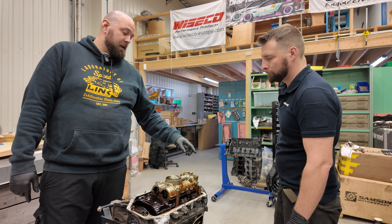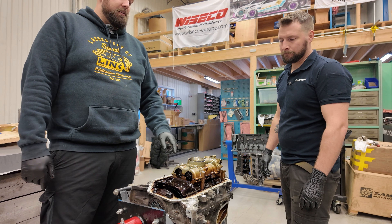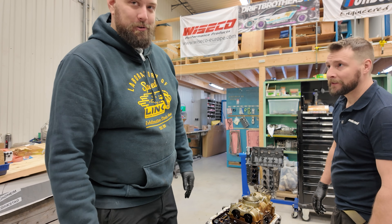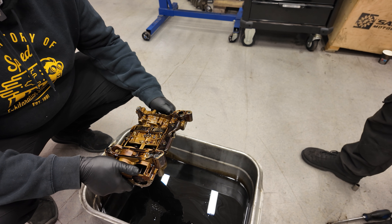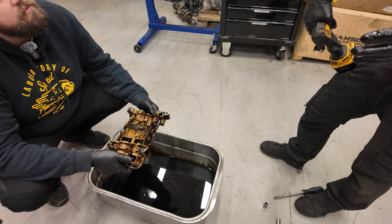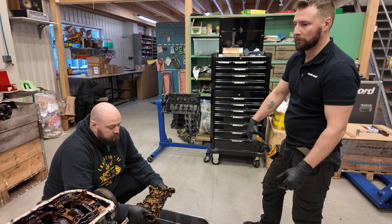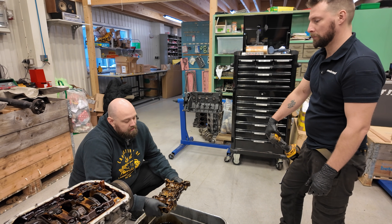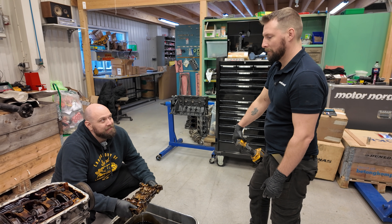We're removing the balance shafts and also the oil pump because we're going to dry sump — we can hopefully get a much lower profile on everything. We've noticed a nice little dent in the oil pickup; hopefully that was done during transport and not during operation of the engine. It's a very long stroke engine, so it's a four-cylinder with very bad internal balance and they run really rough. The balance shafts are there so the car won't vibrate in a normal road car, but on a race car it doesn't matter — it's just taking up comfort.